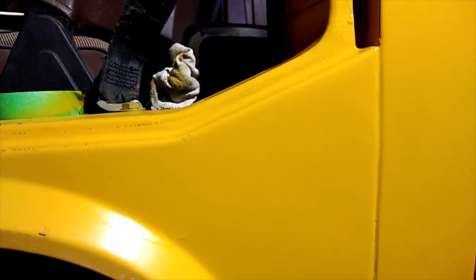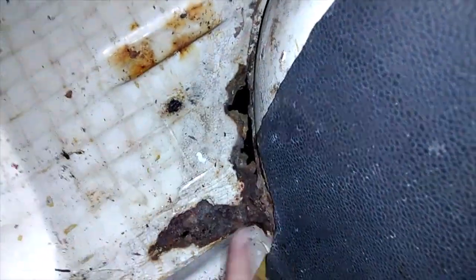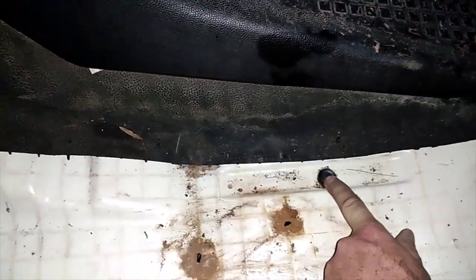The last bit of rust is in the back corner — I think that is the last big bit of rust to cut out on the outside of the car. However, have a look at this — in this corner, a bit of a hole, a couple of little holes there in the floor. This is where they mainly rust of course; water gets up and just stays there. Because they have rubber mats in this particular model, water just stays under these little areas of drooping. There is a drain plug right there.